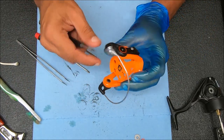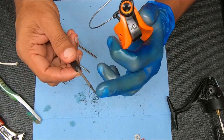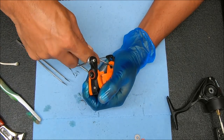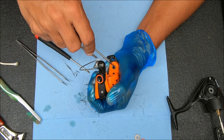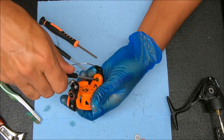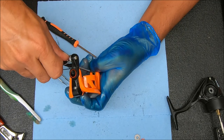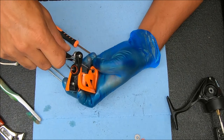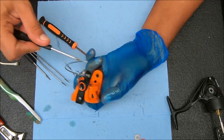Now we're going to remove the bail wire. The way to do that is to remove the two E-clips — one on each side. The best way is taking a really small screwdriver, sticking it down inside there looking for the gap, and just twisting as you pull up slightly. I'm sticking it under that post and then trying to twist — keeping my hand here just in case it wants to go shooting around.